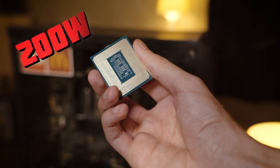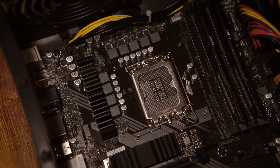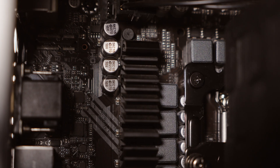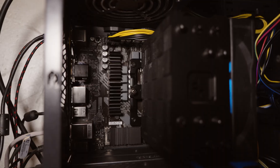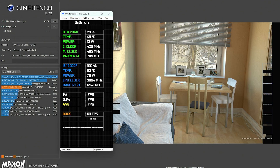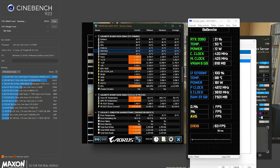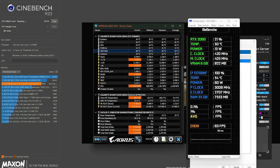And why does this matter? It's power consumption. So why did that upgrade become a disaster for me? Because of this — the Gigabyte B760M DS3H DDR4. It's a good motherboard for CPUs whose power consumption doesn't exceed 100W; the VRM has 9 phases, enough to keep stable power, but the small heatsink doesn't do its job very well with power-hungry processors. The i5-12400F in Cinebench R23 consumes only about 70W without limits, so the VRM held up well and didn't overheat. But the i7-12700KF without limits consumes nearly 200W, and such a load heats the VRM up to 100°C in 30 seconds, causing the CPU to throttle frequency.